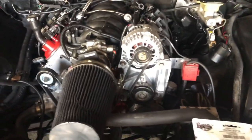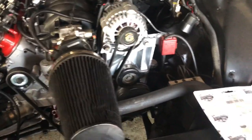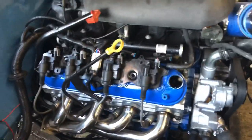What we have here is a '94 Impala with a 6.0 and a 4L80E transmission. The original transmission dipsticks that come in these cars are super hard to install - as you can see, it was extremely hard to get this one in, but it is doable. It just takes a lot of bending and you need a decent amount of space. For this particular application, there's no way you're gonna bend that tube and get it in there. On my buddy Jeff's '95 Impala with the 4L60E, I was able to bend his dipstick tube and get it in there, but this 4L80E is just a different kind of beast.